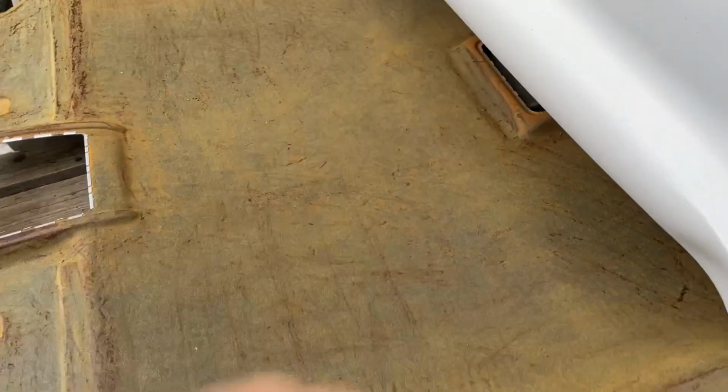So step one, just lay out your material and make sure it's big enough and just square it up. Make sure it's got plenty of hangover, plenty of room all around the outsides. Stick your roll that it came in, or if it came folded up, that's fine. Fold it back. We're going to do half at a time. It really helps to keep it square, to keep it under control. This will stop it from creasing or anything like that. And we're now ready for the glue.